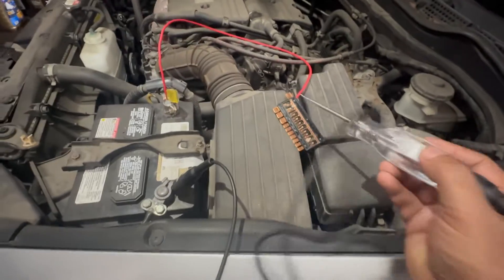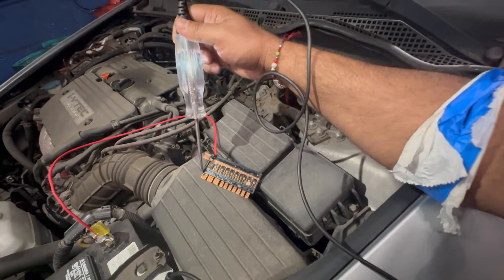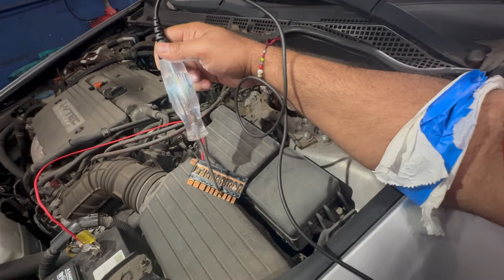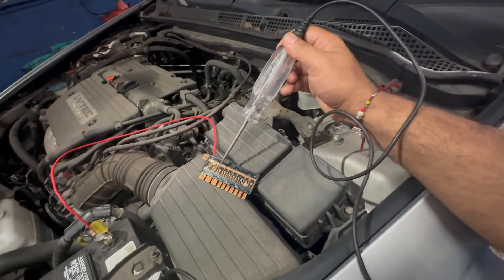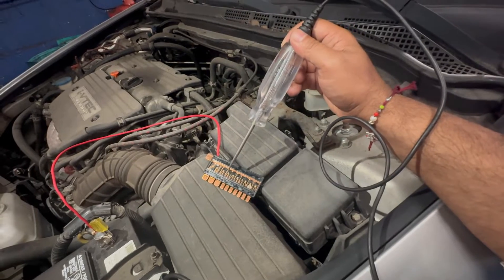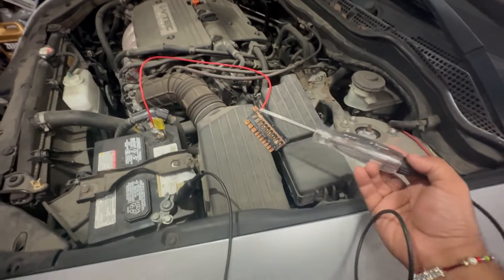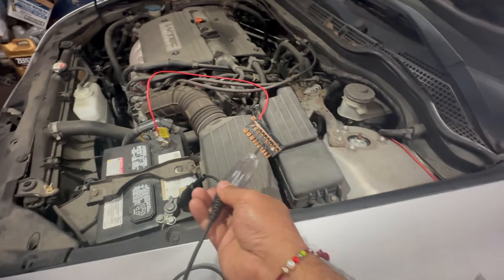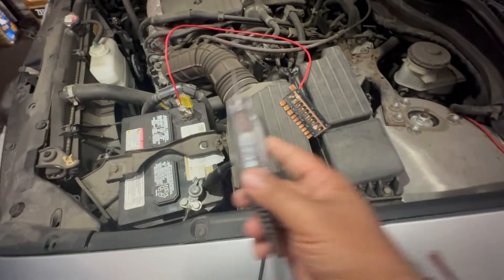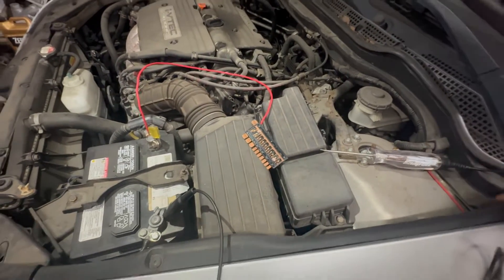That's how you check those. Same thing here — 12 volts in, power should travel through the circuit, and we should have power at each fuse. If it doesn't light up, the fuse is blown. If one part of the circuit is broken or burnt, the test light will not illuminate. It's very simple — same theory, just a different setup. This thing is almost 70 to 80 dollars from the dealer, and if one fuse blows you have to buy the whole unit. Anyway, thank you for watching — don't forget to subscribe, share, and like. See you guys in the next video, and if you have any questions, don't hesitate to send me a message.